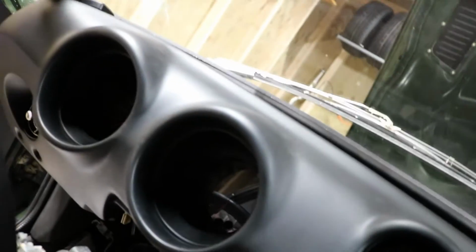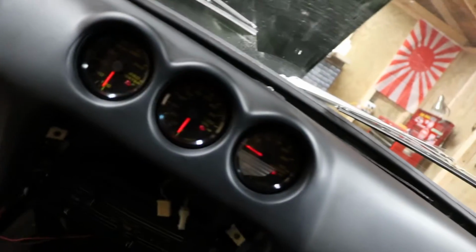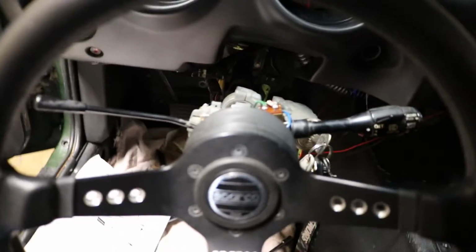So I have almost everything hooked up, everything I should need, and I turned the key on and I turned the lights on, and the running lights would come on, but not the headlights. And the needles for the gauges would light up, but not the actual gauges themselves. And so I started wondering, well, what the heck, and I was checking my wiring, which now is unplugged at the moment, that's why they're not coming on now. I haven't retested it yet.